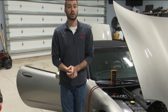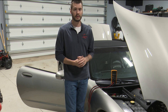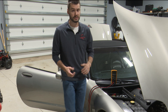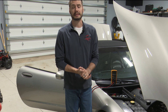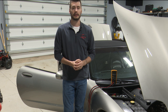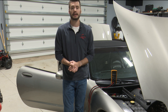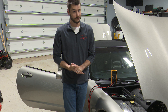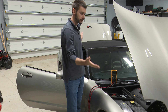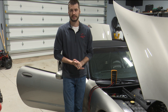Your battery should last quite a while. It's going to depend on the vehicle and the reserve capacity of the battery, but realistically, this 2000 Corvette behind me should probably still start up after it's been sitting for two weeks. Right now I can't even let it sit overnight without the battery going dead. We have to jumpstart it basically every time the customer wants to drive the vehicle. The vehicle itself for this test doesn't really matter — you can apply this testing to any parasitic draw test.